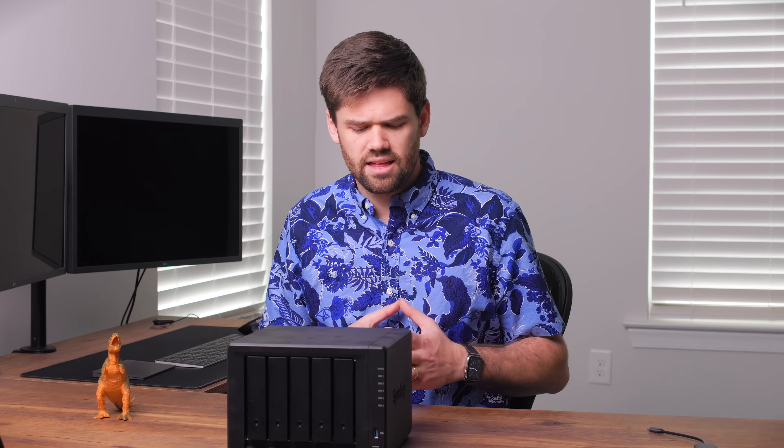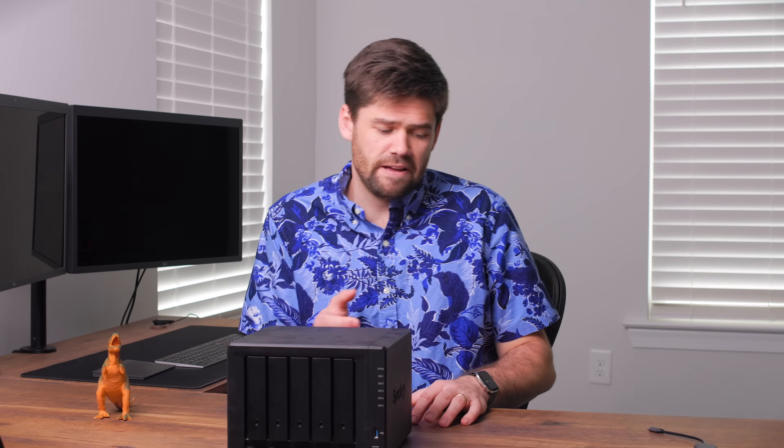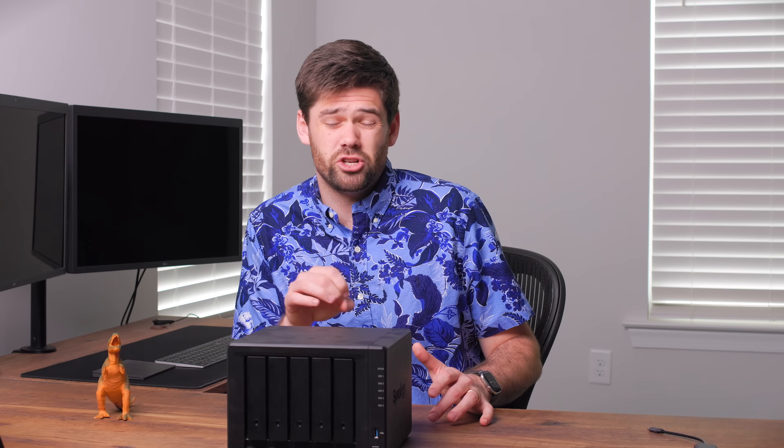The next place I would upgrade is an NVMe SSD for caching, and you do not need two of these. Just buy one and buy the smallest NVMe drive you can, as long as it's at least around 100 gigs. You want to set up read-only NVMe SSD caching for your volume. Realistically for the vast majority of users, 50 gigs is going to be what's actually heavily used. People who go with two one-terabyte drives in read-only really are not going to get that much more performance versus someone with a 100 gig one.